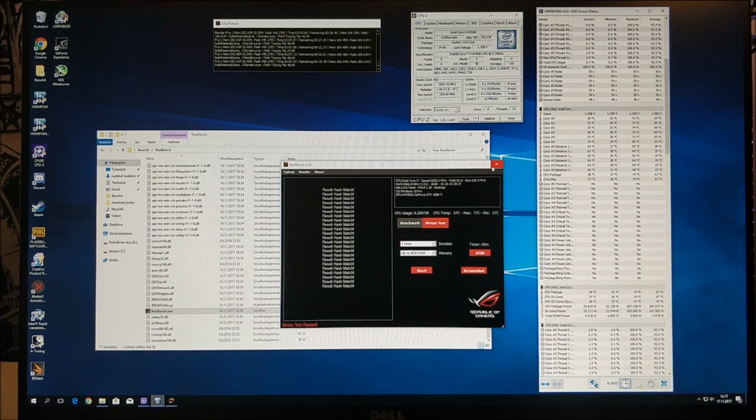My main point with the 8700K is that I want a CPU that is AVX capable for 5 gigahertz, and this CPU unit seems to be one of those, even though it has to use over 1.4 volts to achieve that. But that's only with Prime 95. As you saw with Realbench, with other AVX programs, this is able to achieve AVX stability with a lot less voltage, 1.392, and that's pretty decent, I'd say. And with the offset, I can be gaming with 1.35, 1.36 volts, so that's pretty decent.